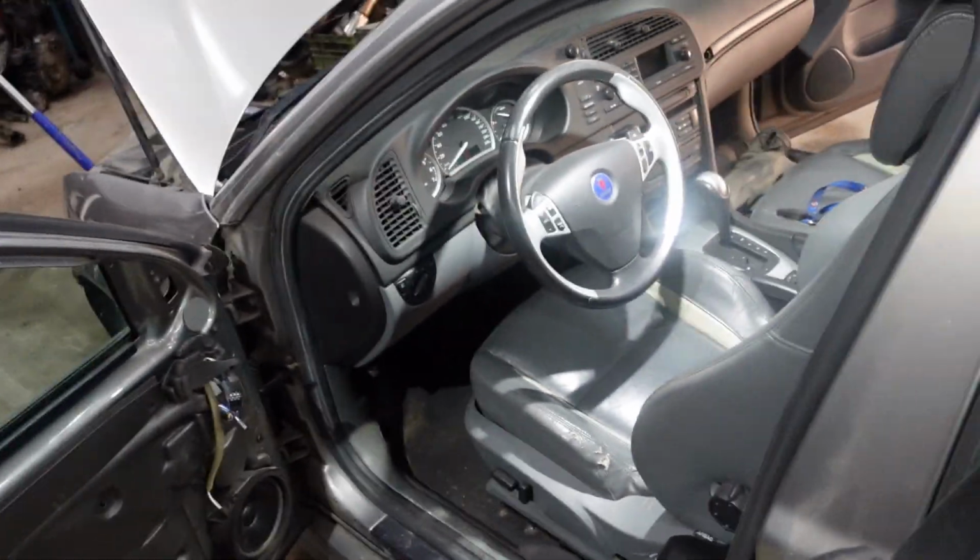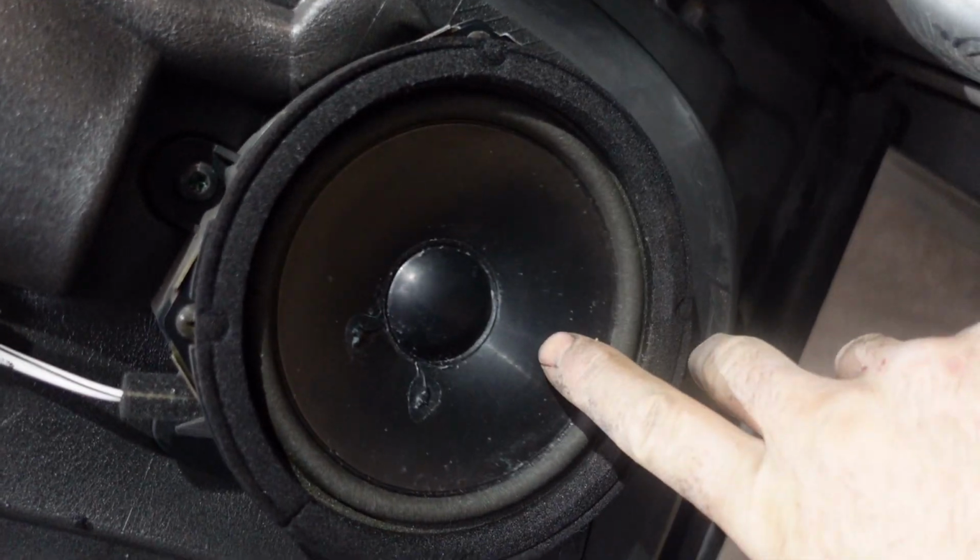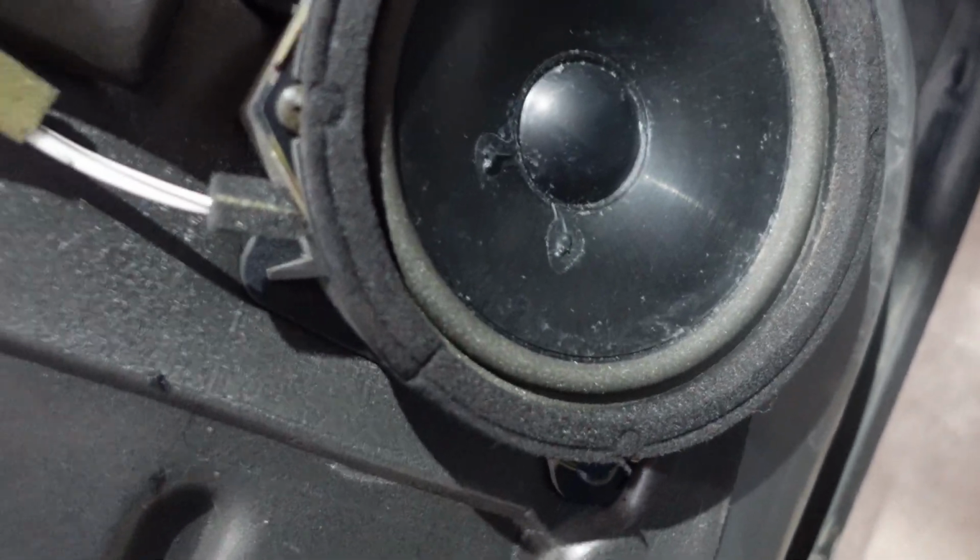Now I'm gonna see if the radio is gonna work without programming. So the radio is working. So the amplifier doesn't need any programming. If anyone was worried about buying an amplifier and worried about programming, it doesn't need any programming, just make sure that you buy a good one. If it's too rusty, the chances are 50-50 that you're gonna have failure with your amplifier.